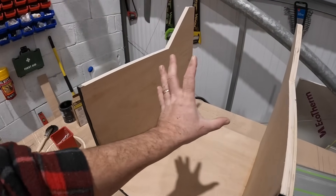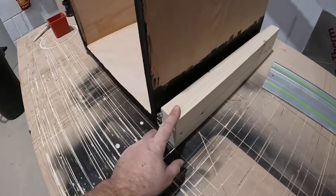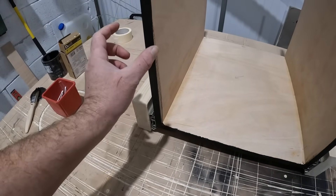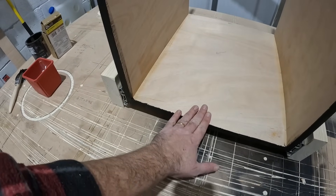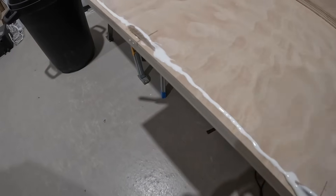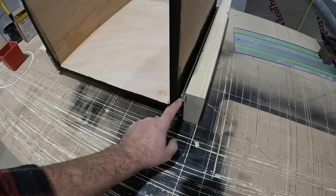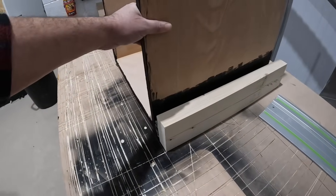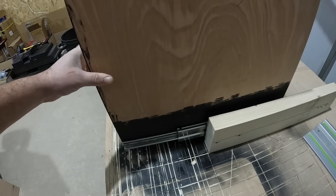We're making some progress. I took the toilet out and it was actually damaged on the front, so we've got to get a replacement — but it's a good job it was here because I needed the measurements to build this. So let's have a look at what I've done so far. This is the box — the toilet's gonna sit inside here. That's the back end. I've got these heavy-duty runners here and here, with the joint on the 18mm because all the weight is bearing on the sides and the base. I've used 18mm ply, glued, biscuit-jointed and screwed it, and the runners have been attached to both the 4x2 and the box frame with some rather long thick screws, and I put loads in.